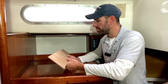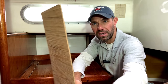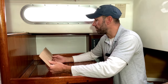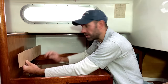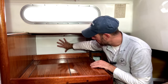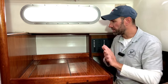That headlining material has just been stuck on the original lining. This piece here is veneer on a backing of very very thin plywood — about 3mm thick — and gluing veneer on thin plywood is much much easier than just gluing plain veneer. I templated it first with cardboard or paper, took it to the workshop, carefully cut it out, brought it back slightly oversized, trimmed it down to fit nicely into this area. I used the same material on the back face here, and the headlining piece I was able to take down, glue on a flat surface and screw back up.